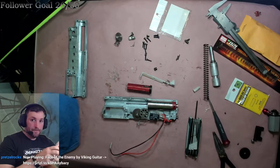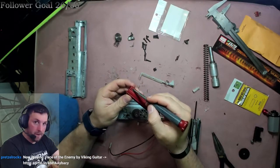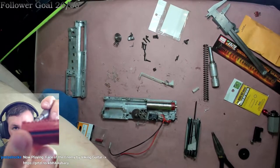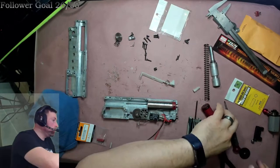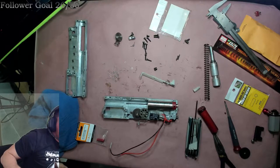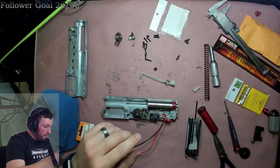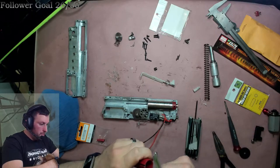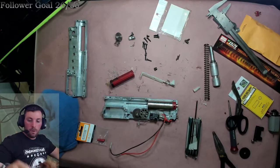Yeah, so in any case, to fix that, what we are going to do is I'm going to take a knife and I'm going to cut this tooth off entirely, and then we're going to push the piston back a little bit with that pad. And I don't have a sharp knife, so I think I might just use these trauma shears. Trauma shears are a very good tool to have because they cut everything really well. And they're pretty cheap, so a lot of times you can just work it like that, but that doesn't seem to be working at the moment.